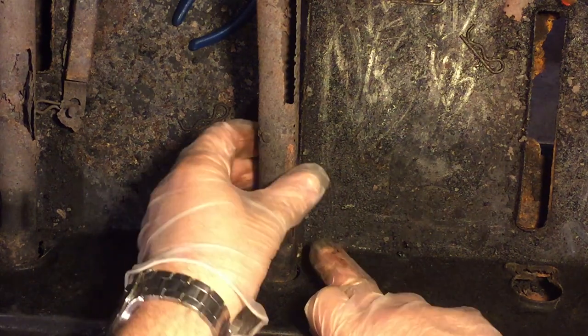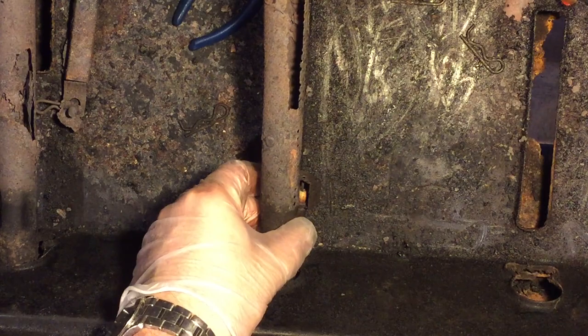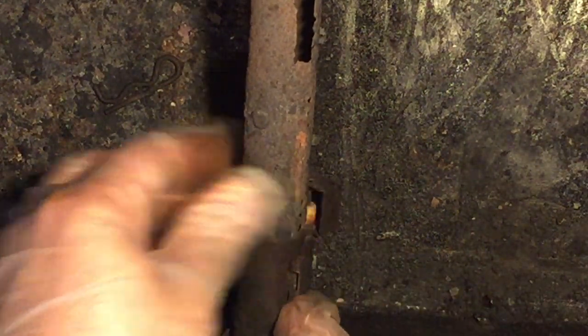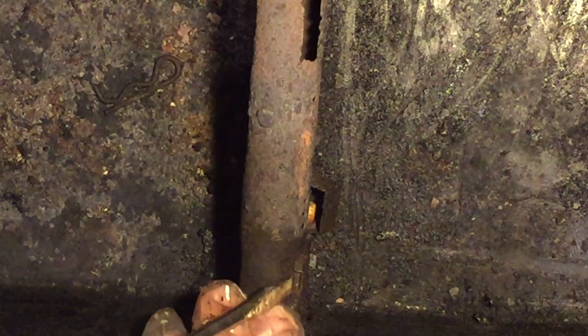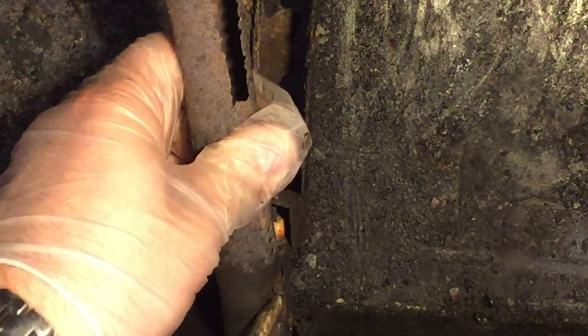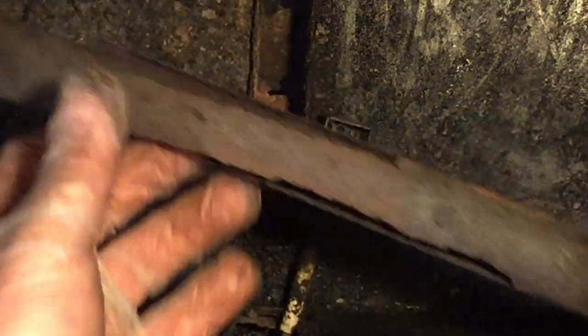As you can see on this burner, the igniter is right there. So we just want to take off, this igniter is clipped on right there. So we can just take a flathead screwdriver, wedge it in between that clip and the burner, and then just slide off the igniter housing. Might be enough. This burner can come out.